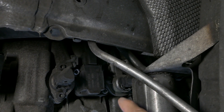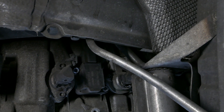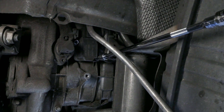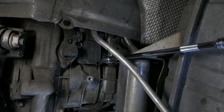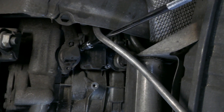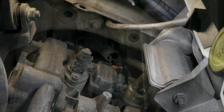I'm going to attempt to remove the two screws that hold in the first coil pack, and that looks like it's going to be a star bit. What I have here is a T40 on a little holder that extends to my quarter inch extension. We'll go ahead and essentially just break it right off just like that — you can reach it relatively easy — and that is removing the very first couple bolts off the first coil pack.